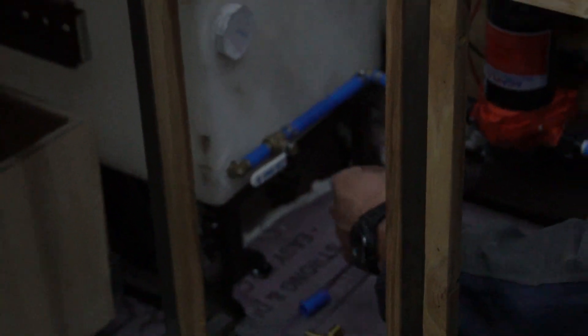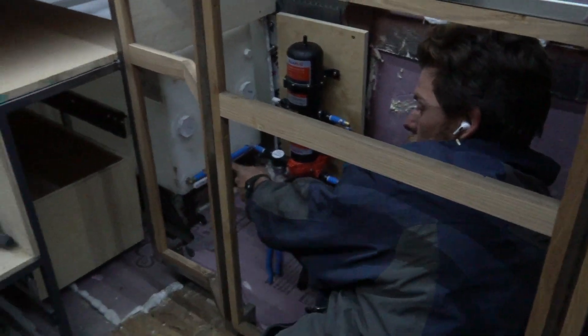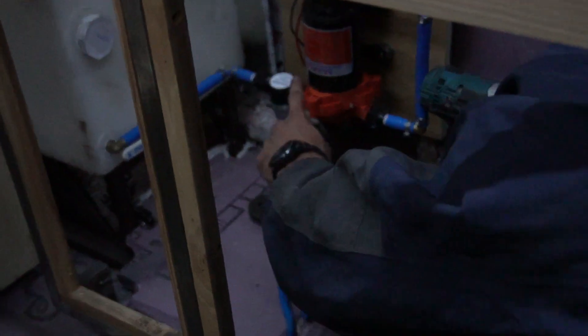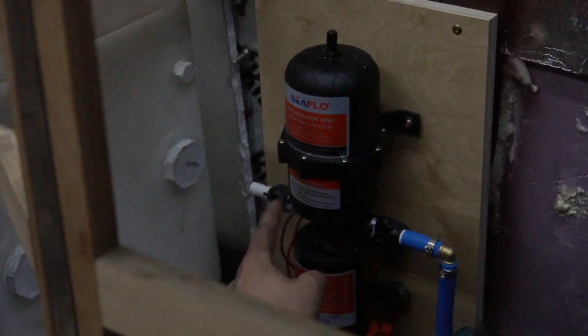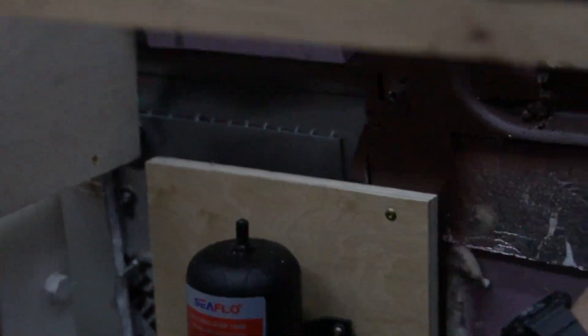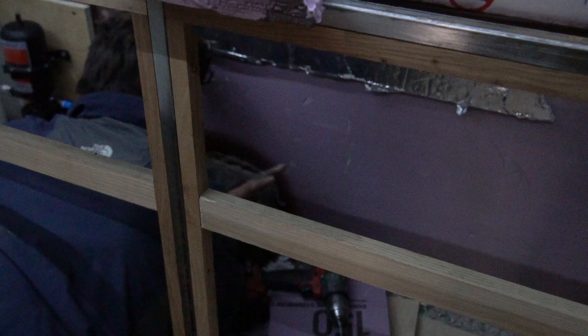Here's where all of our water is going to come out. I have a valve here, so if we have a leak anywhere on the system you can just shut it off and there's no water in the whole system. From there it goes to a little strainer first — in case there's any plastic or mold that grows in there — then through our pump, up to our accumulator. I ran it this way just to save space, and then I'm going to tee off here and run a hose back to our sink and water filters.